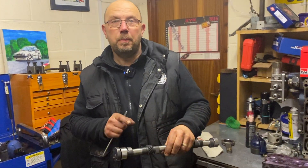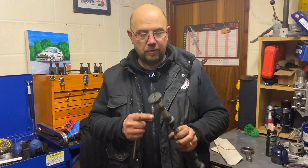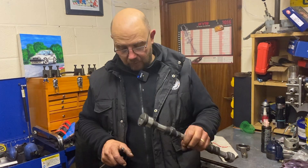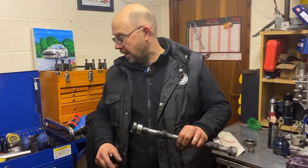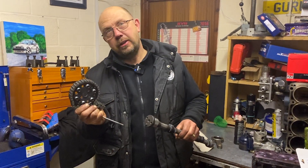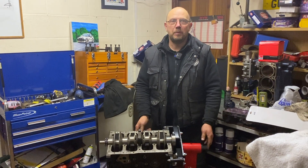We've just thinned the camshaft down. I could have put the cam in the lathe and just turned it down smaller all the way around, but I felt that just thinning it in two places left more metal in the core and saved weakening it. Now we've got a crank that turns and a cam, and I've tested it installed with the vernier fully advanced and fully retarded, so we know the con rods will now always miss the cam.